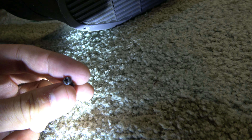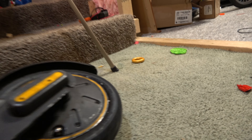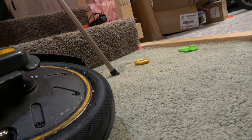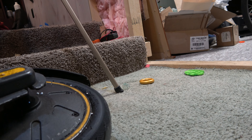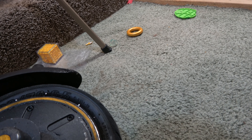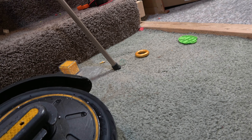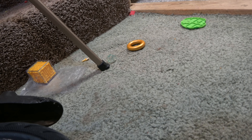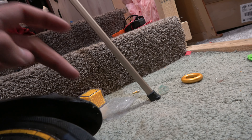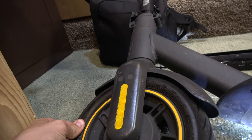This one has a slot cut in it. Looks like a Dremel cut into it because it's not centered or anything. So someone's been in this before. I also realized there's a bunch of grease and stuff on the back, and the tire's flat - and it's like brand new tires. But if you notice the rotation, this tire's on backwards. And due to all the pry marks on the edges, looks like they replaced this tire and rode through asphalt or something - it's all sticky and nasty. This other one appears to never have been unmounted - still has air in it.